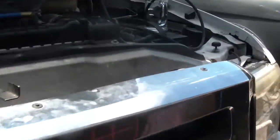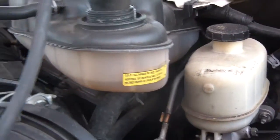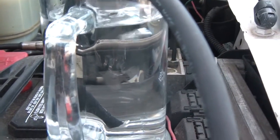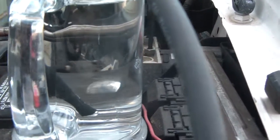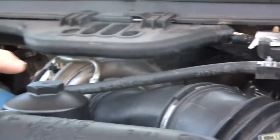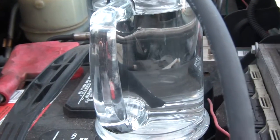I have a little pressure cap connected to my coolant bottle here, and you can see some air coming out — not a lot. It looks like it's coming from like a return here on the EGR cooler.